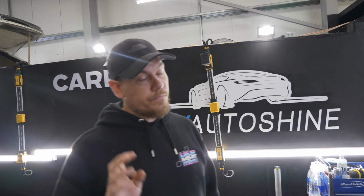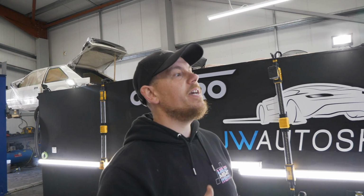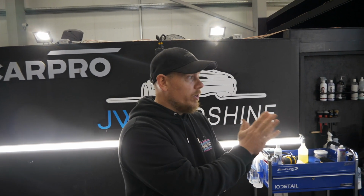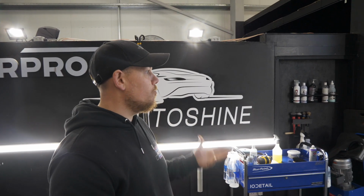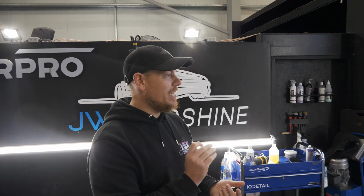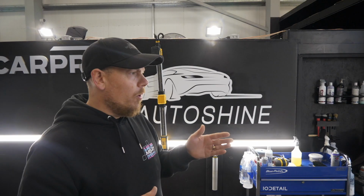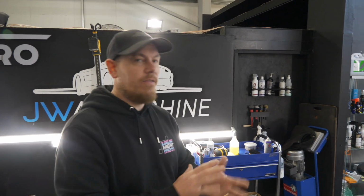One thing we did notice, and it's good news, we took the micrometer, the paint depth gauge, and we went round it, and the whole car is OE, other than the bonnet. No way. It's original paint in every... What? Yeah. So I am shocked. Yes, fair enough, the bonnet has been painted. Yeah. But the shell, the roof, the tailgate, the doors, the wings are all exactly between 80 and 110 microns of paint. Yeah. And the machine said factory paint, no signs of filler work. So it's actually a really honest car. The bonnet, we couldn't improve it any more than it's at. Like George said, it's a race car. He's quite happy with how it looks.